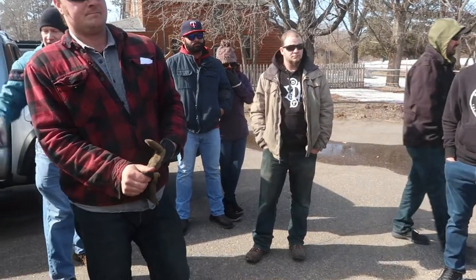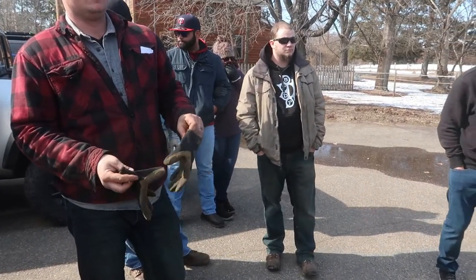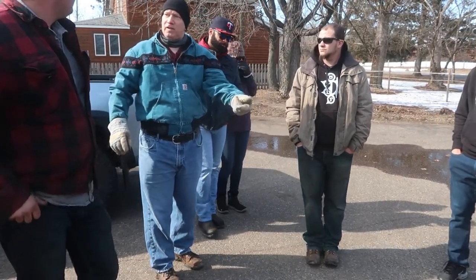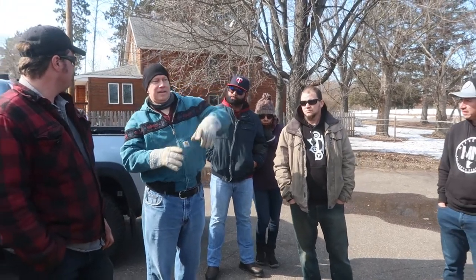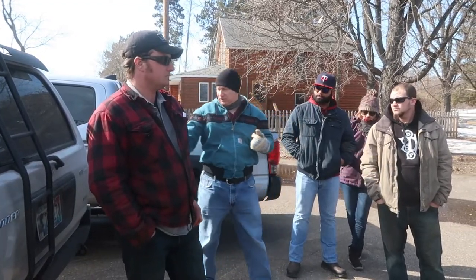He pointed it out to them. One of the bumpers, it was like, you don't want something like this, because it'll tear right through the bumper, it'll pull right out. Just to pull straight, I've actually gone around the vehicle and gotten in the woods a little bit so I could pull straight. Yeah, it kind of sucks to get off trail, but instead of trying to pull at a weird angle, I've just driven my Jeep around so I'm in line with the tow point.